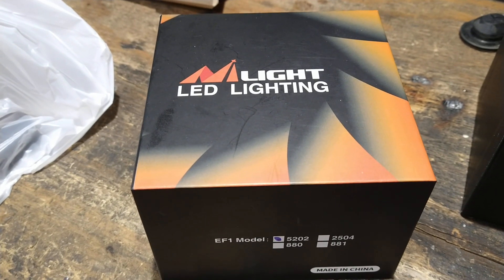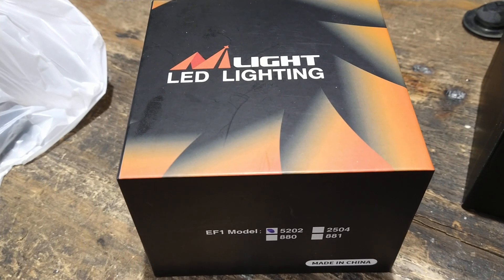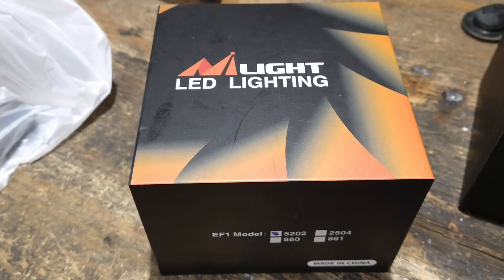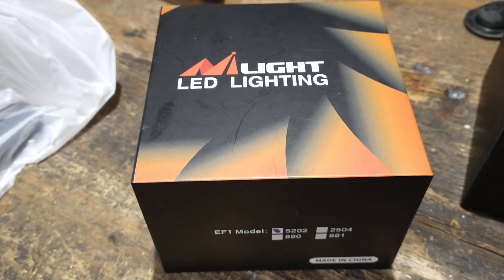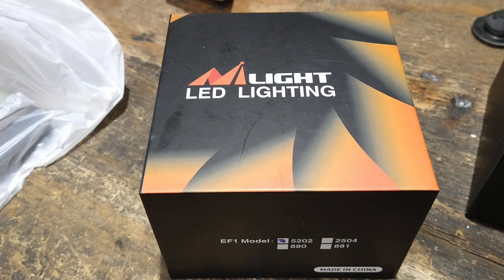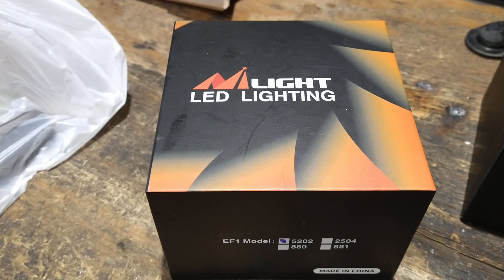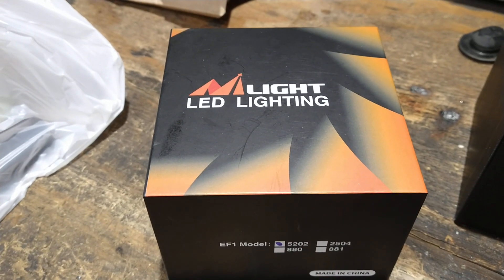It's not going to affect it if you have a USB drive in there or you're listening on your phone, iPod, or Bluetooth. But if you're listening to AM or FM, it does definitely disturb the broadcast — I'd say by about 50%. If you're in a city and you have a real strong broadcast, you're probably okay. But where I am, I'm about 35 miles away from the broadcast station with some mountains in between, and it was just a deal killer with these LEDs.